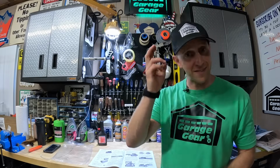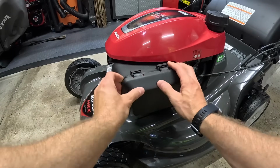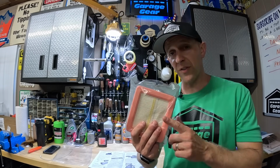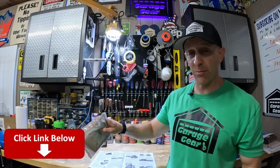Honda definitely had maintenance in mind here too. Oil changes here are incredibly simple. Simply tip it over, pour it out, refill it, and you're done. Air filters are easy to change out too, right underneath this cover. And by the way, it's best to buy those air filters in bulk. That way you save a lot of money over the life of the mower. And I'll have these air filters linked down below in the description.